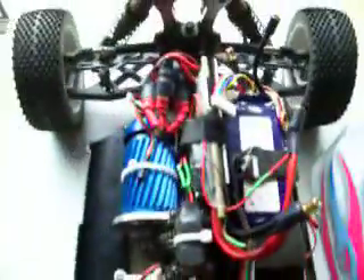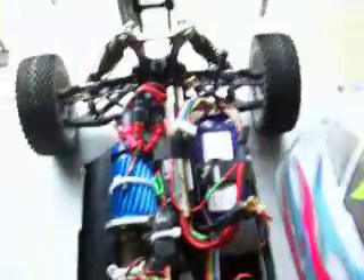That is my BEC there in the center diff. I also have temperature sensors going out to the motor and to the battery, and there's an internal temperature sensor in the speed controller. All this is done for safety reasons — the speed controller will keep track of how hot the motor and battery are. The LiPo balancer keeps track of what the individual cells are at voltage-wise, so if one dips below a certain voltage, it'll cut the circuit and stop the motor.